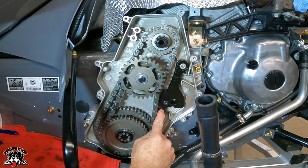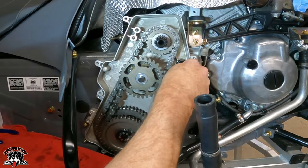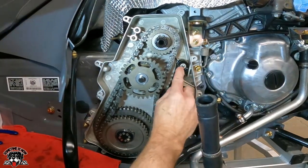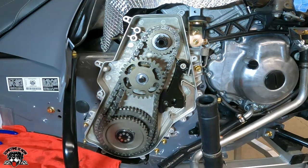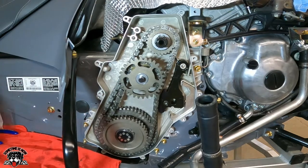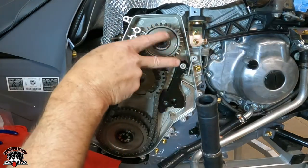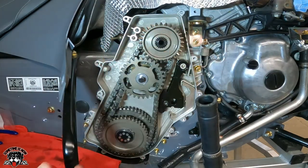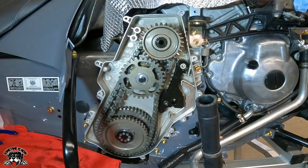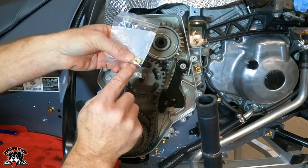Remove the steel roller and put the shoe in. Loctite red on both sides. And then once we get everything, we can adjust that. And we got to still do the upper shift fork, so we'll just set that there for now. So we're going to go over to the bench and we're going to change out those plastic shift fork ends to the brass.